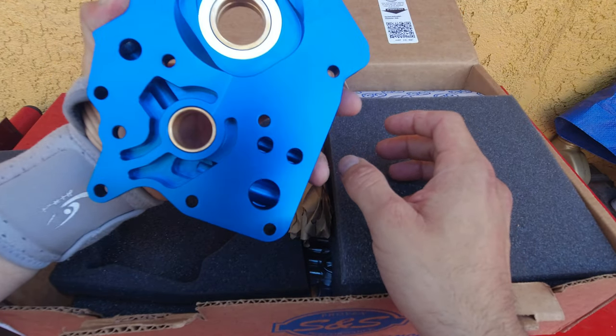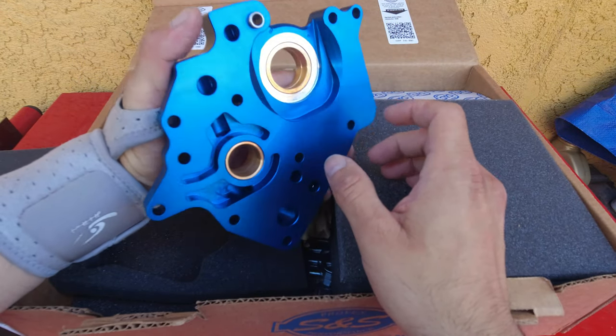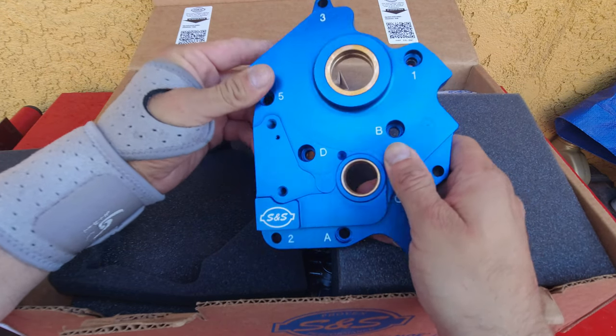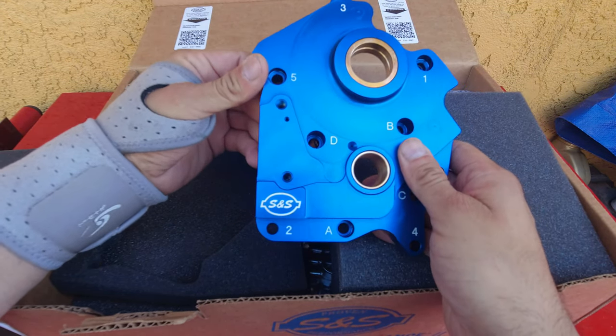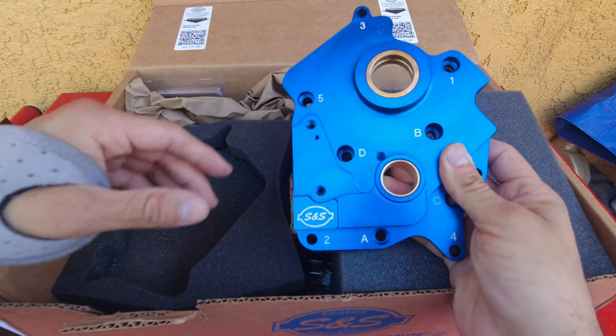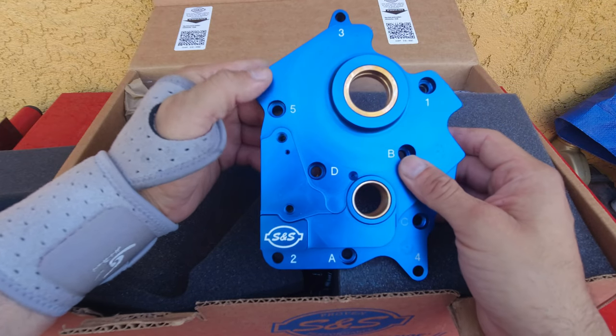This is high quality. There's a little clearance for your high-lift cams. This is a 475, so we don't have to get into the heads — this is basically a drop-in or bolt-in cam. We don't have to worry about lifting or removing the heads and changing the valve springs.